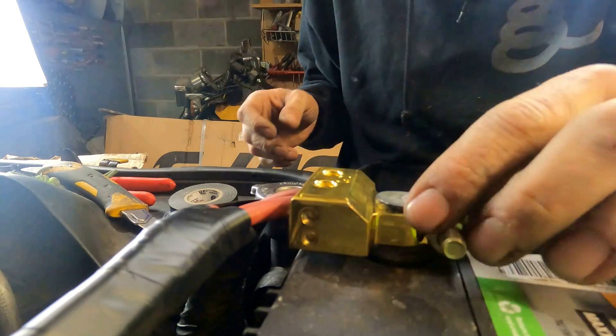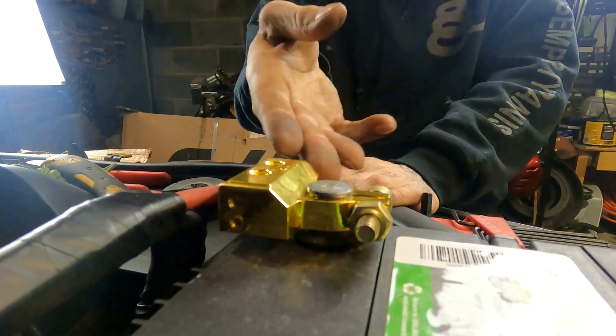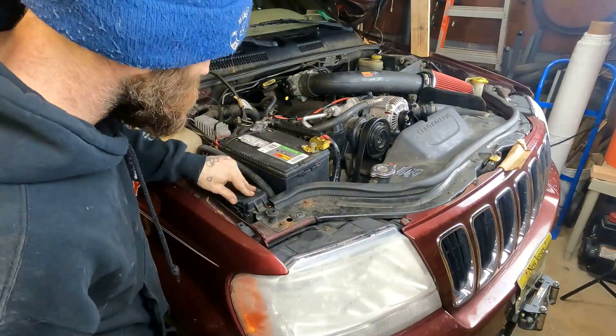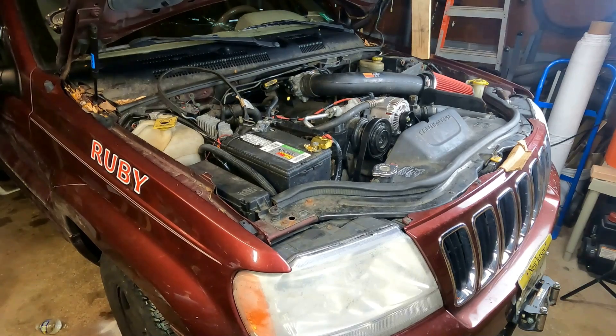We'll see how these zinc-plated gold-looking bougie connectors hold up. I have my doubts — if they had not been one of the cheaper options, I got this set for $15, I wouldn't have gone for it. I was looking for something different, going to get that old sheet metal one, but these hopefully will last a little bit longer being cast like they are. Let's make sure it does that, move all our tools, close our power distribution block — I hear dinging, it's a good sign. Oh yeah, look at that, she's even charging! We got 14 volts, friends — that's what we set out to have. Not 40 or 50, not zero — 14.